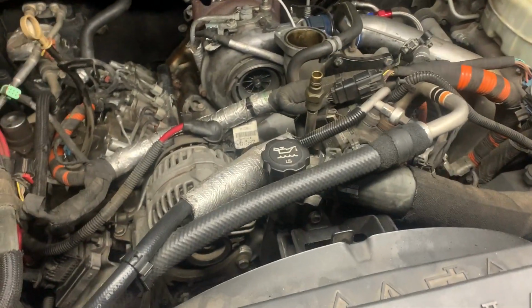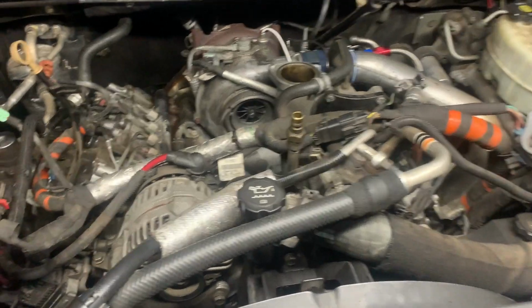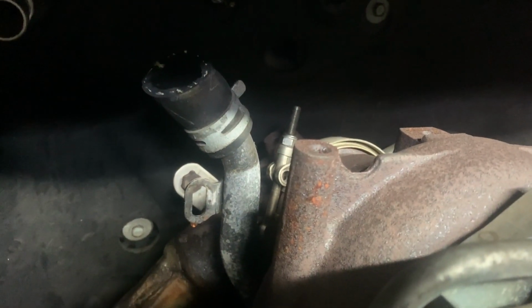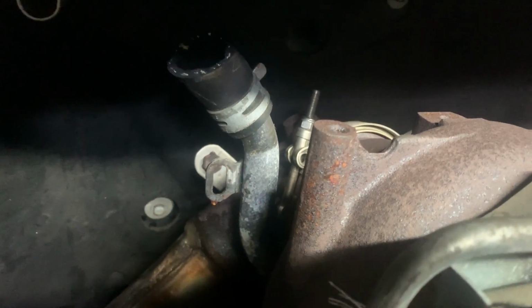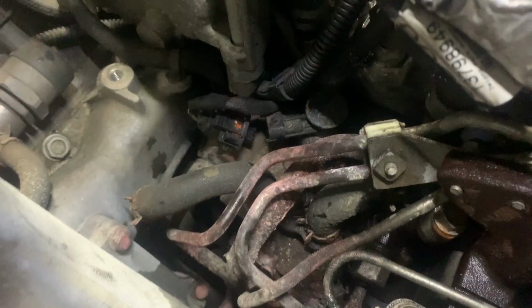All right, this is where I'm at the end of the first night. I don't have a whole lot left to take apart. Everything downpipe wise, that coolant hose, I just chopped that off because that's going to be disconnected right below the downpipe. The clamp's loose. The EGT probe's already out. That one I cut, so it's just going to come out with the other one. This is what we're working with right now, and that's just from coolant leaks.